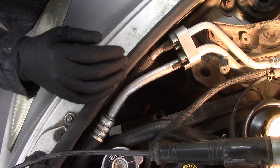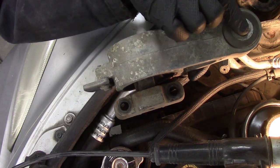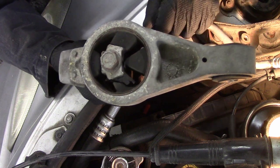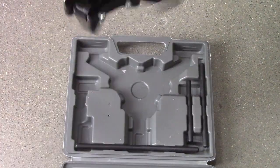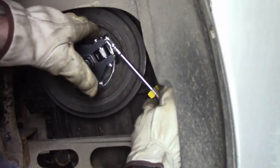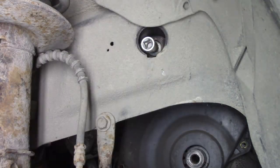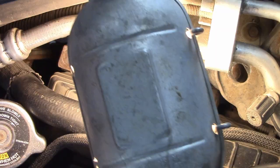I disconnected the cruise control bracket — something I didn't need to disconnect — in all the effort to get this motor mount out. This attaches to the front of the motor; this attaches to the inner fender, and as you can see, it pretty much needs replacement anyway. So I have a new one coming, and the one down below is pooched as well. I neglected to show how to remove it — just use your imagination. I did, however, have to buy a new harmonic balancer puller. It's not a typical front snout of an engine — this one pushes a rod through the hole in the front of the harmonic balancer. I had to wait a bit for that to come from Amazon. There is a third motor mount in the middle — one on top, one on bottom, and this one in the middle just to swear at you. Got that apart.